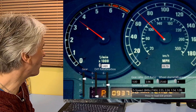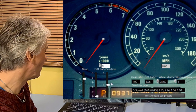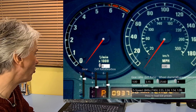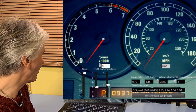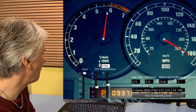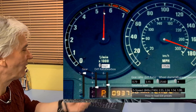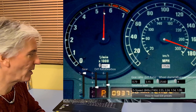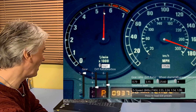That's why I went for 3.15 - well, apart from the fact that you could get hold of them. With a 3.15 differential, first of all, have we still got a 155-mile-an-hour supercar? Let's go up to 5,000 RPM. Yeah, no problem at all - that ratio is about 175 miles an hour. So we've still got a 155-mile-an-hour supercar, thumbs up for that.